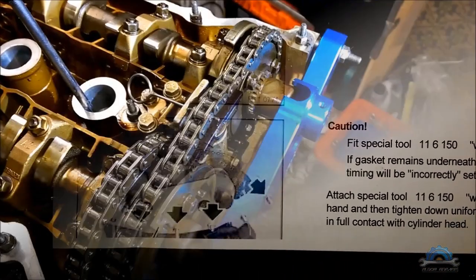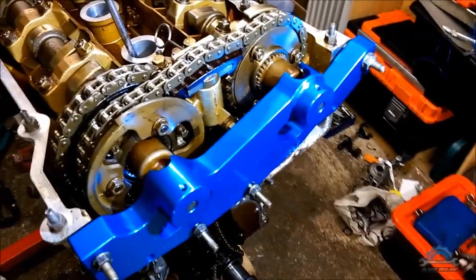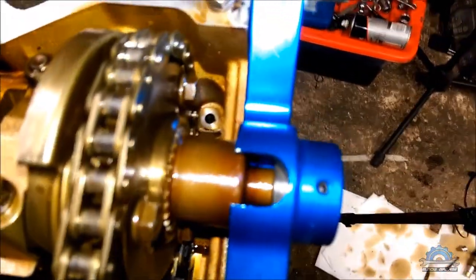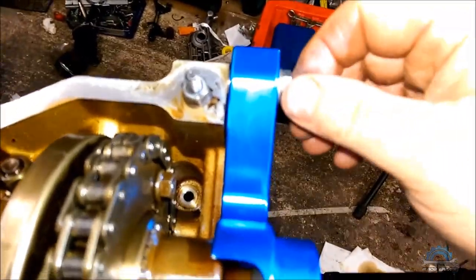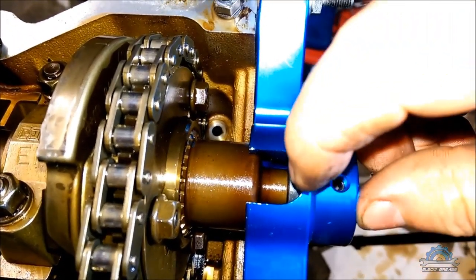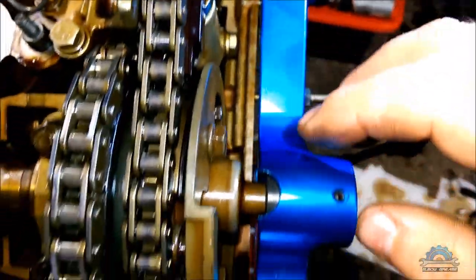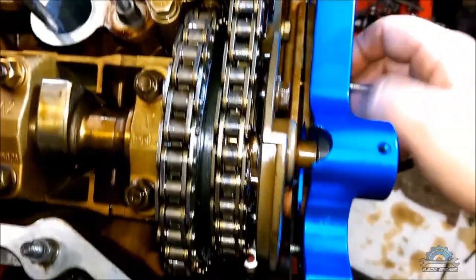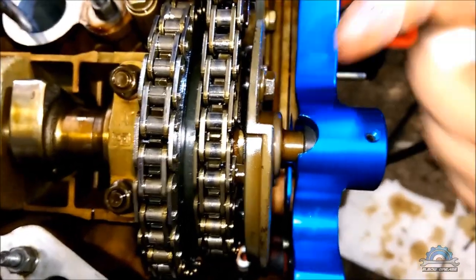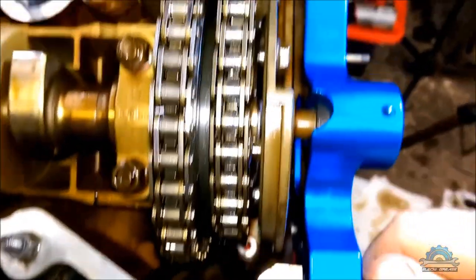That's the jig. That's what you're gonna do now. Okay, the jig is on. And screws, very important thing. When you're tightening this down, you can't have any gap between the splines and the tool. If you have a gap after tightening down, you can't proceed further. You have to go back, you have to pull the splines back so they're touching flush with the tool.